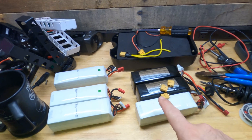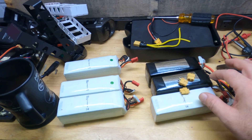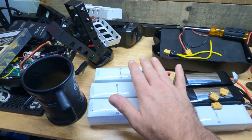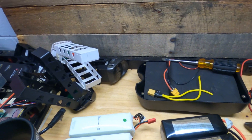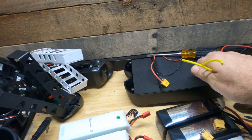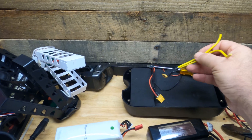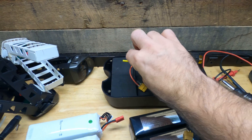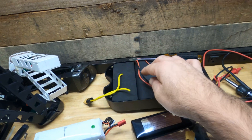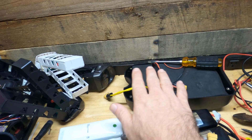Here's the quick scope of the project — I have six batteries, each 22 volts. Connected in series that gives me 66 volts. I'm going to form two separate packs that can be plugged in together and into the main battery as range extenders. I don't want to do much modification to the box — I'll take this pigtail with its battery connector, drill a hole, run it out, and splice into these two wires so it still feeds the main board. Additional batteries will complement the main battery, all feeding to the main board.